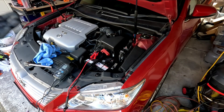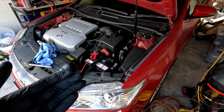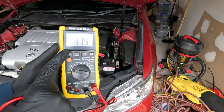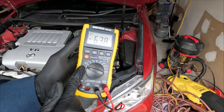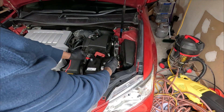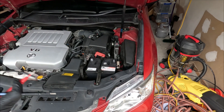It's worth charging the battery and then driving the vehicle. A short drive won't work — you need about a 20-mile drive for the battery to be fairly well charged. Now I've fully charged the battery. To test voltage with a multimeter, set it to DC 20, then probe the positive and negative terminals.